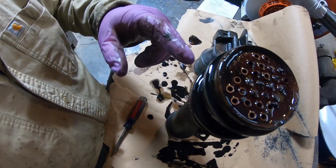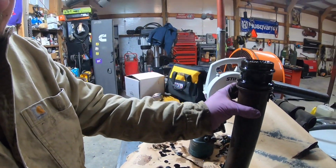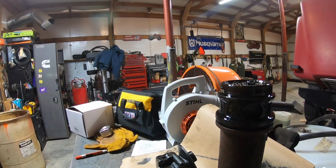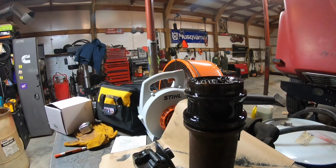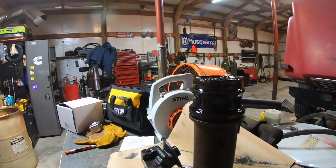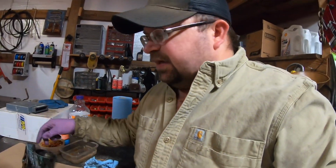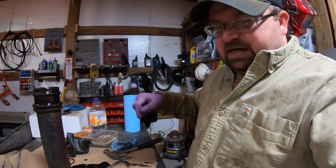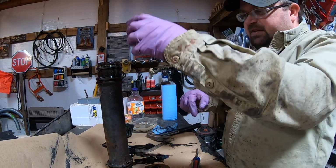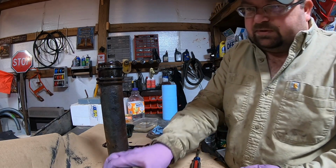And I'm going to spray brake cleaner back in this oil port as well, and flush it out with brake cleaner. That way, if I got any water in there from that degreaser, it won't make a mess. It'll clean it out and flush it out good. But I end up just taking a hammer and lightly pecking around them lips. You gotta be careful not to break it, cast aluminum, but just helped that thing up and pecked around it, and it dropped down off onto the table.